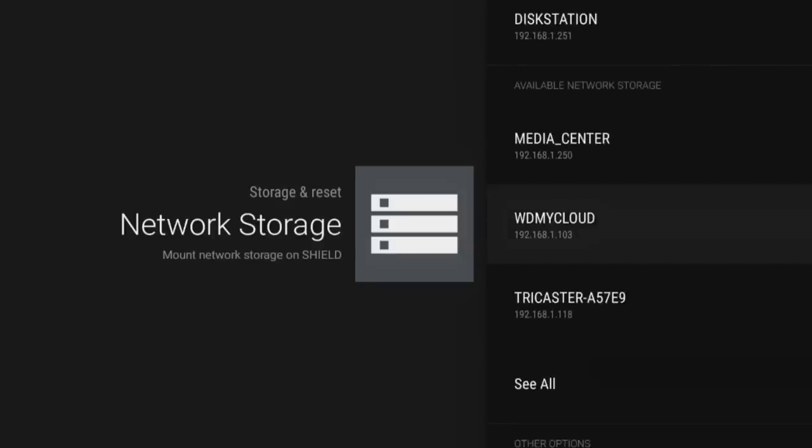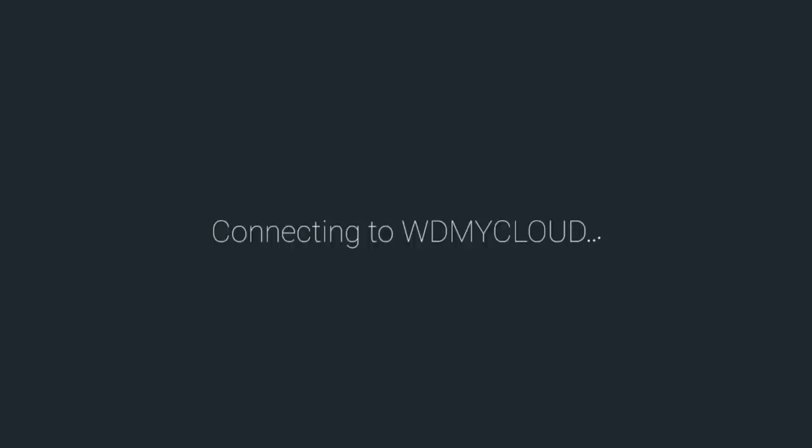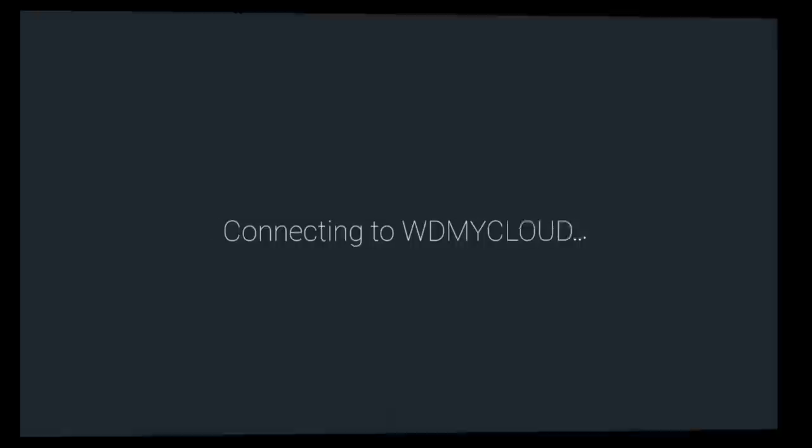What I'm going to do here is show you how it works when you want to connect to something. I have my WD My Cloud here in the house. I'm going to connect as a guest so that way we don't have to go through the username and password rigmarole, but if you wanted to connect to a username and password protected directory you would just go ahead and put that in there. This does take a little bit of time to get that connection established. Once I found it was connected it then works, but it does take a little bit, so don't get nervous if this takes a little bit longer than you think it might otherwise take.